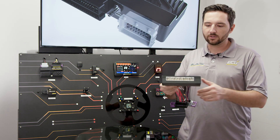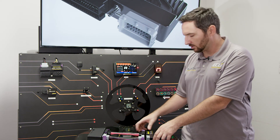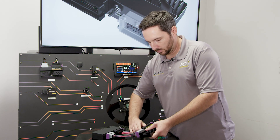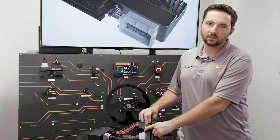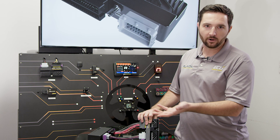We made it very simple to install. These are your factory ECU connectors right here — you take your factory harness, plug it in, grab your EMU Black, plug it in, latch it, and you're done. The EMU Black, as always, has a built-in four-bar MAP sensor that reads up to 42 pounds of boost, so you just connect a vacuum line to it. You don't have to wire in a MAP sensor.